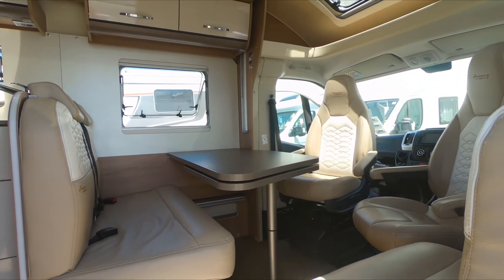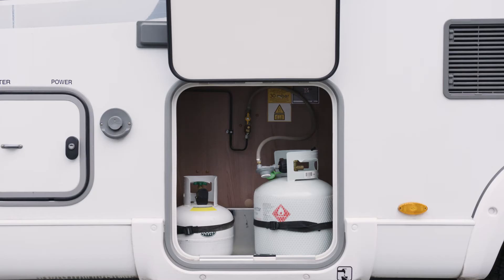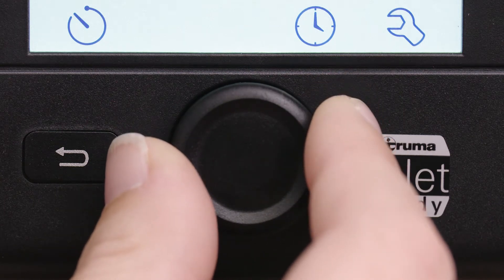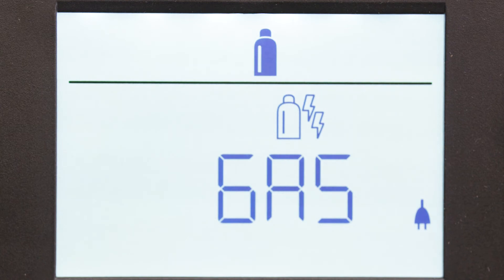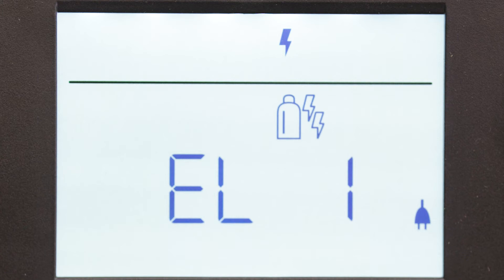This bit's really important. The easy to use central heating system is one of the joys of a wilderness motorhome, especially in the winter. There are quite a few settings, so please pay attention if you want to stay warm on your road trip. The heating system heats the living area and hot water. It operates from the 240 volt mains power system when the motorhome is plugged in, and from the LPG system when you're freedom camping. Turn on the heater by pressing the rotary push button for three seconds. Then select the energy source by turning the rotary push button to this symbol and tap select. Select gas if you want to heat with gas. Select mix if you want to heat with gas and electricity. Select EL if you want to heat with electricity.